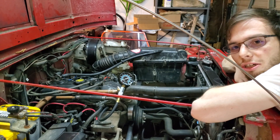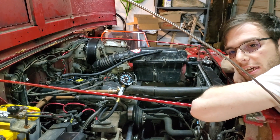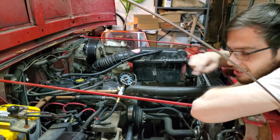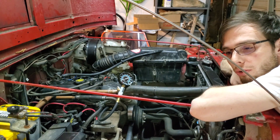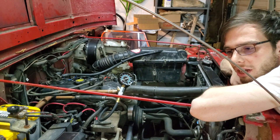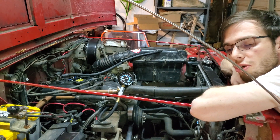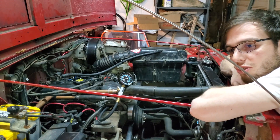This next test is going to test the compression in the cylinder, and I'm going to be doing this with the engine in just a cranking scenario, so I'm not going to be running it. To do so, I disconnected the injectors and the wire to the coil, so really all we should have is the starter turning over the motor. The engine is relatively warm still — it did just run and had been running for quite a while prior. I want it to be a relatively warm engine, as compression will increase as the seals expand. We don't want to waste time and let the engine cool off.